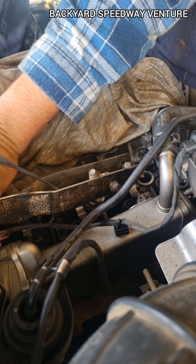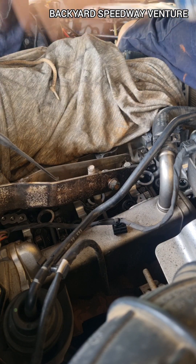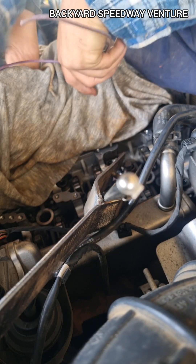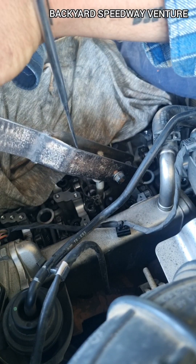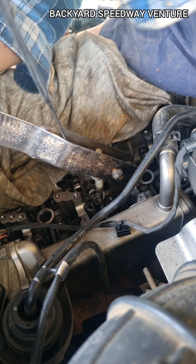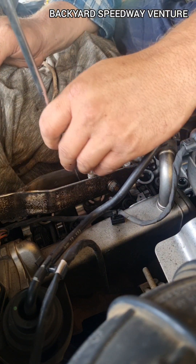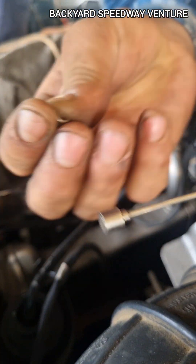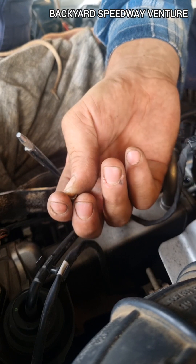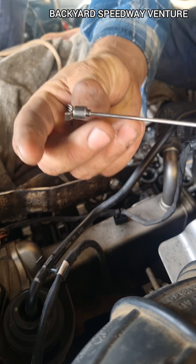What I might do while I'm doing this is get something to hold this down for me so I can spare my hand. I've got a piece of electrical wire with a loop there, so I'll line this back up and feed the wire through the end. Look at that — my valve spring is just sitting there compressing. The biggest thing now is this tiny little collet here — I've got to try and put that on the valve stem without dropping it. If I drop it and it goes in that motor, I'll just about cry.